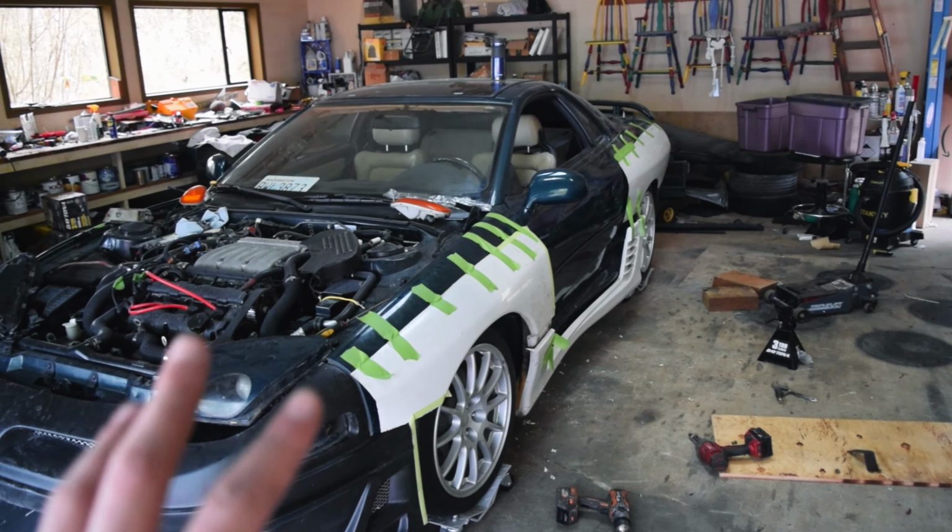We have finished our first round of cutting. The front fender was a piece of cake because there's no extra metal that we're going to need to weld up behind that. We just need to make sure that is smooth and then paint it over so it has rust prevention on it. As for the back itself, this one is a little more complicated, but really not too bad overall. So essentially we cut out the outside, and then we cut slats in the inside and then pounded them up to try to be as flush as possible.